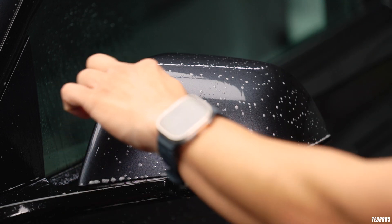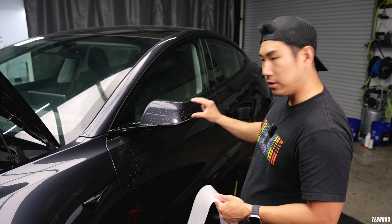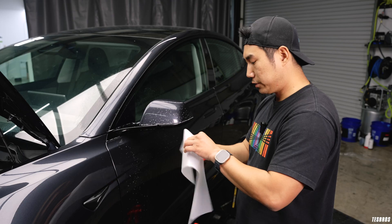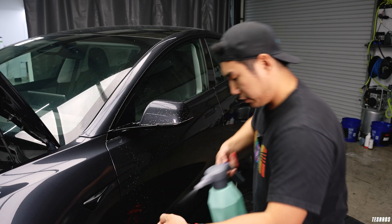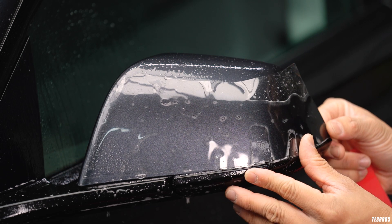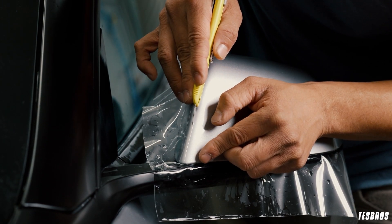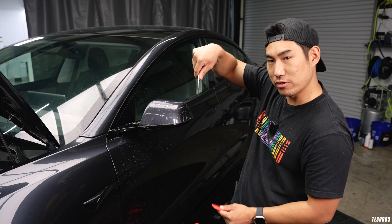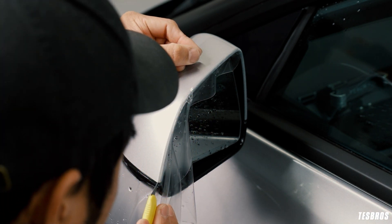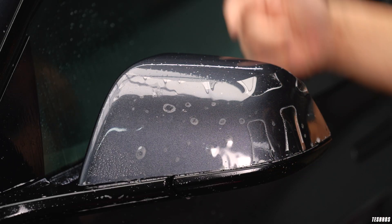The kit has two pieces — remember I showed you where all the material was bunching up? That's exactly how we designed ours. The concept here is: tack here for alignment, pull it past this line, and then connect the next piece into that. You're also just dealing with less material, which makes it so much easier. One important note about the bulk method: you have to cut it with a knife, and that's honestly the riskiest part. If the angle is too deep you'll actually cut your car and damage the paint, so I never really recommend using a knife unless you're experienced.